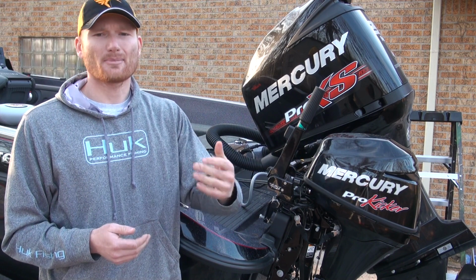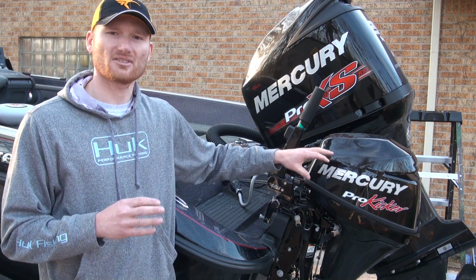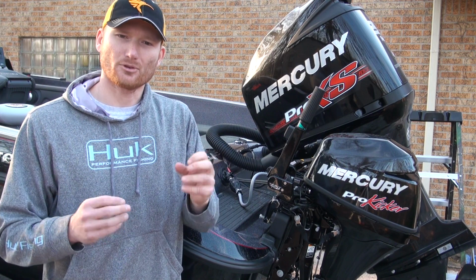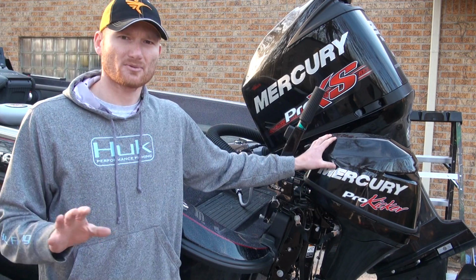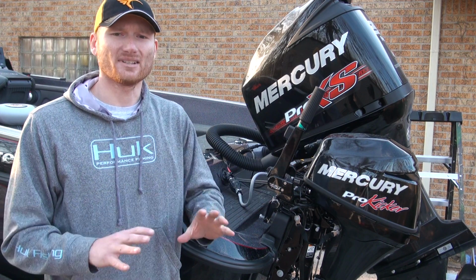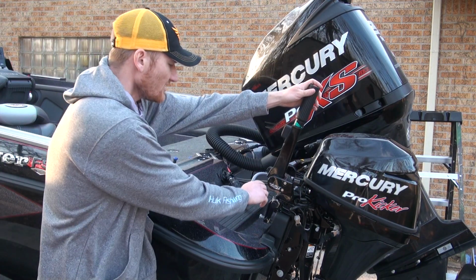And what I do is I run about 1 ounce to almost 1.5 ounces less than what they say. And the reason is simple. These little engines, as they idle around, because I'm using it just to kind of putz around and troll with, it's actually going to make oil over time when running at those low RPMs. So we're going to have more than what we started with. They'll run just fine, even though I'm sure that I'm not supposed to say that out loud, but the truth of the matter is putting too much oil in them is a really bad deal. So make sure you get just at, or maybe even a little bit below, and you're going to have a lot better deal.